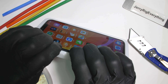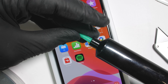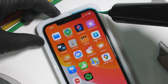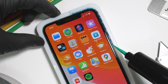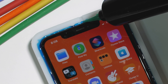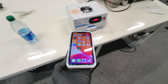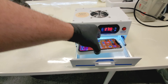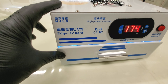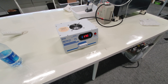The white plastic mold is just to hold the phone secure while the machine is doing its work. The blue goo — that waterproof sealant — is helping keep the milky abrasive from entering through the microphone holes, around the edge of the screen, or through the earpiece — all ingress points inside the phone where we don't want that liquid. Once we're done caulking around the edge of the phone, we put it inside the UV light, which cures the adhesive — very similar to the adhesive we used on the glass-only Apple Watch repair we did last year.